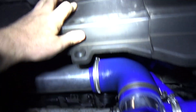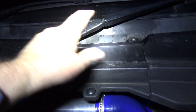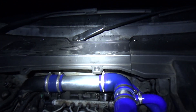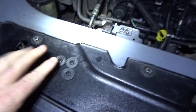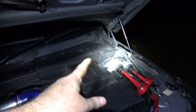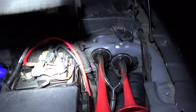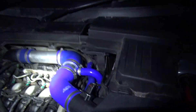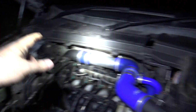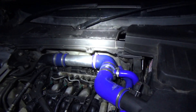That sits perfectly in there — it's now rock solid, there's no gap. It's pushed that in underneath the metal strip on the bottom of the glass and stops the panel moving around. I'll be selling these as a set of five — one, two, three, four, five. Use those underneath the standard plastic rivet things and your scuttle panel will be nice and solid.